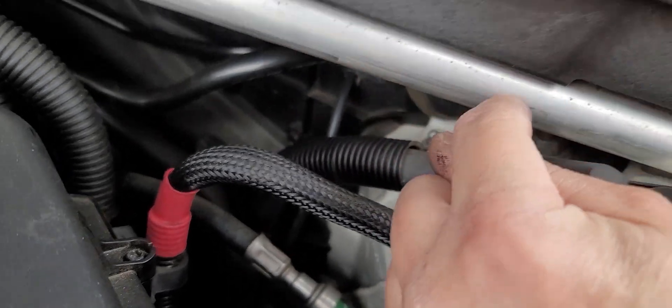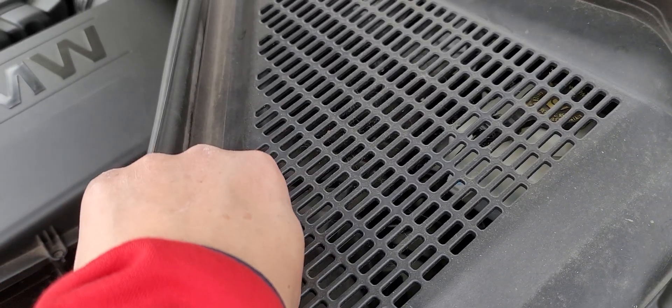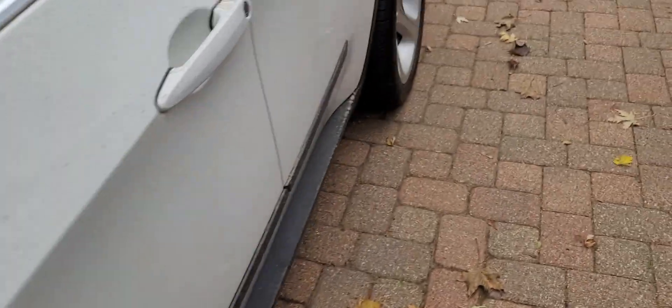It went right through on the side here, and it goes behind the brake booster and down. There's a rubber grommet in there. Once you remove it and look down there, it's pretty much self-explanatory. If you drill that hole big enough you can just feed the wire right through and grab it on the other side. Just make sure if you drill it out you don't hit the brake booster, or you'll cause yourself a whole bunch of trouble.